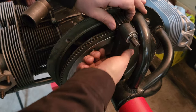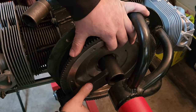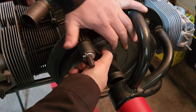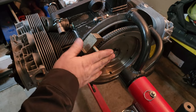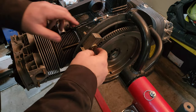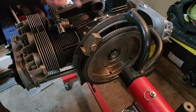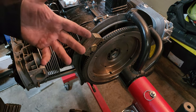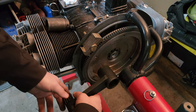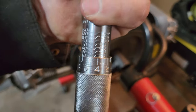I'm going to use this torque multiplier to start tightening her down. I slapped that flywheel lock bolt in there — you don't need to put a nut on the other side, it's going to be fine as long as you've got a bolt that's a good size. 25 foot-pounds it is — 25 foot-pounds of torque. And we're there.